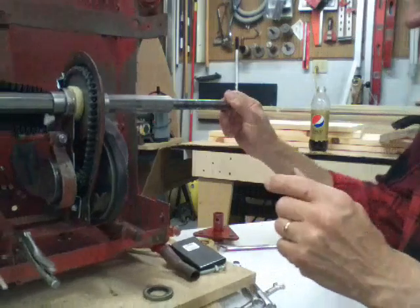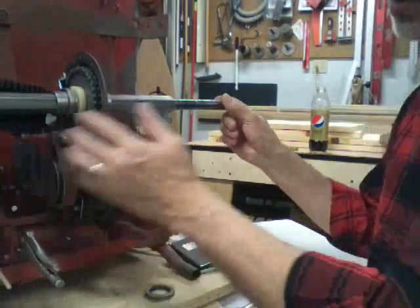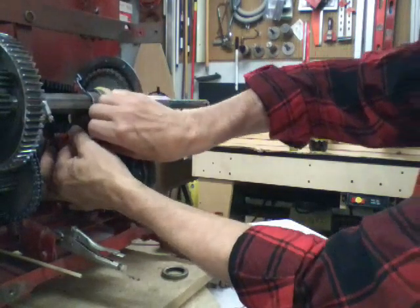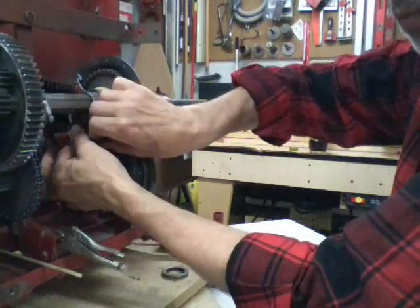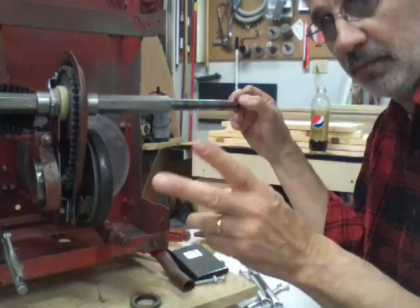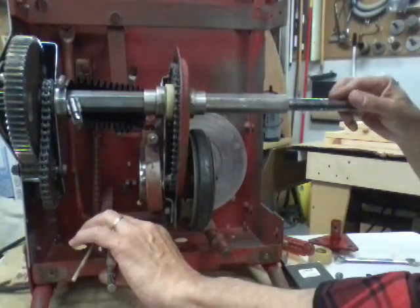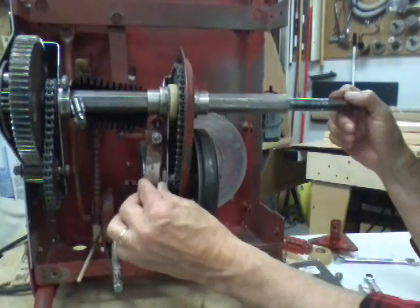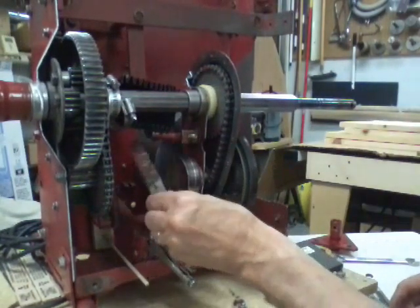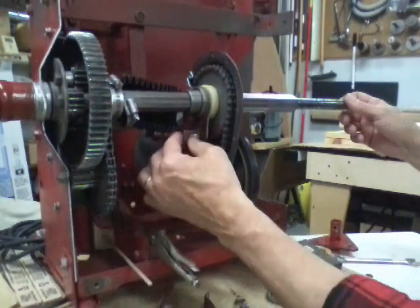If you have to take the other one off, keep working. Right here is a bolt that holds the linkage onto the chain case — that's what shifts it. Take that nut off. Now depending if you have a two-pedal or a one-pedal machine is where your cables are going to be hooked. On a two-pedal machine, one cable activates your clutch; the other cable hooks to this brake. These band brakes are the best kind — much better than the little goofy shoe brake inside.